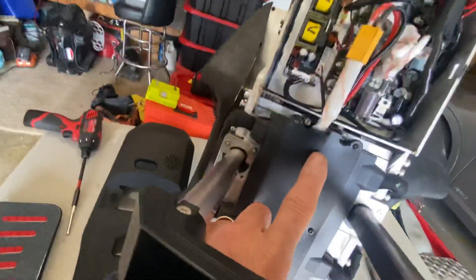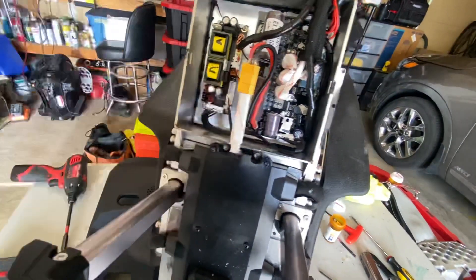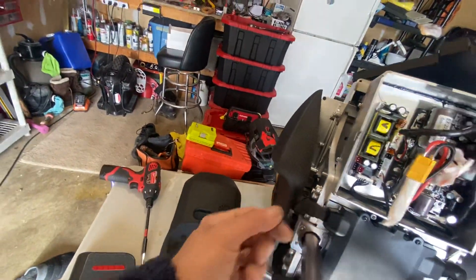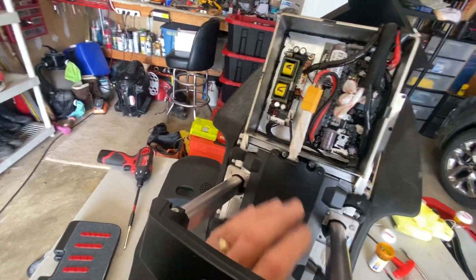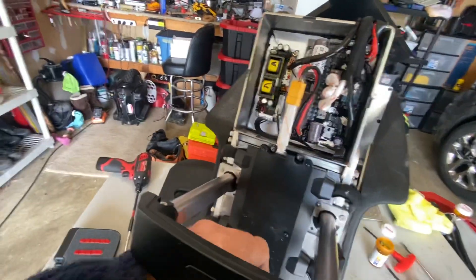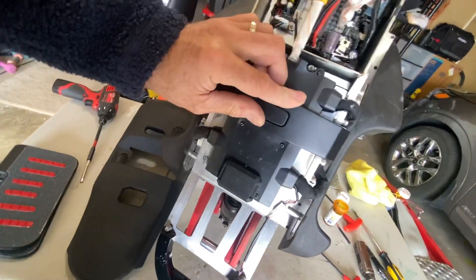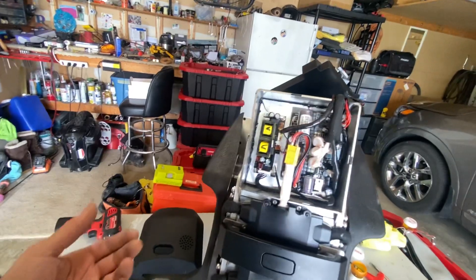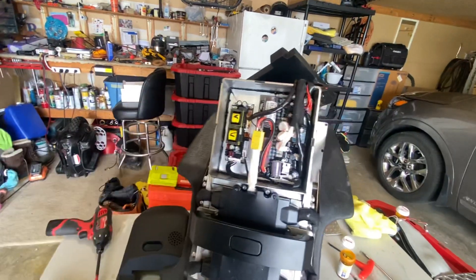And then this here has six screws that comes off, and that is where each battery pack's wires are going into here. And then the circuit board under here has to do with your charging and discharge port to the motherboard, etc. And that's where your charge ports are. In my opinion, this is one of the easiest wheels to get to to change the motherboard or DC board.